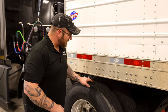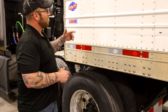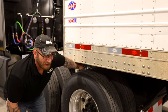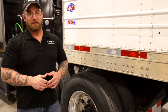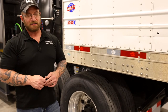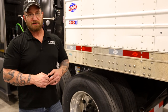Now we're going to talk about hooking up the trailer. First thing we want to do is make sure we're the right height so we don't overshoot the fifth wheel plate and run our reefer unit into the back of the cab — that's a bad day for us. So I check here and make sure we're the right height and I'm not going to overshoot. Now I'm going to climb back inside the truck and back underneath this trailer and do a tug test. Remember, every time you hook up to a trailer, make sure you do a tug test and a visual inspection on your fifth wheel to make sure the jaws are latched so you don't drop this trailer going down the road.